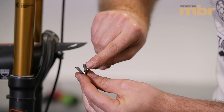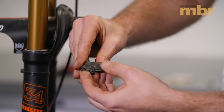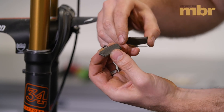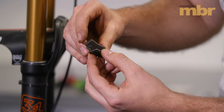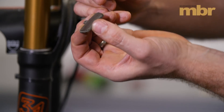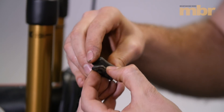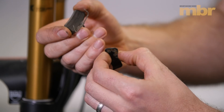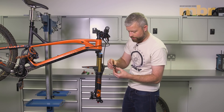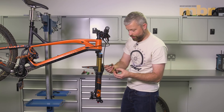You'll see the backing plate, which is the metal plate on the back — it's going to be rusty — and on the other side is the friction material. This pad's actually still got a bit of life left in it, but once they start to get to half a millimetre left, then you're going to want to replace them. Any less and you risk damaging your rotor and your brake won't be working.